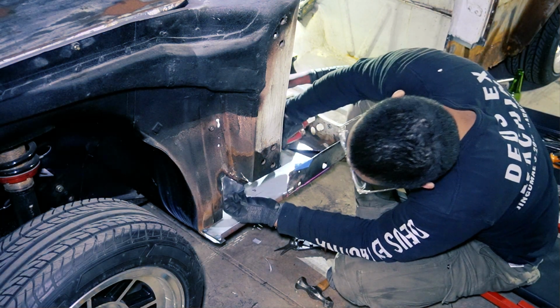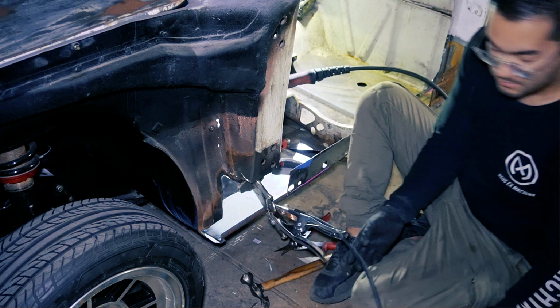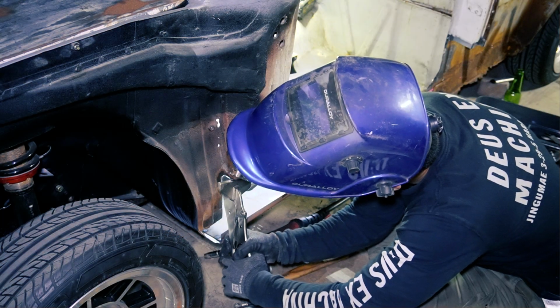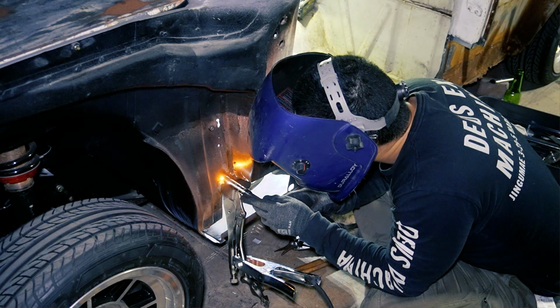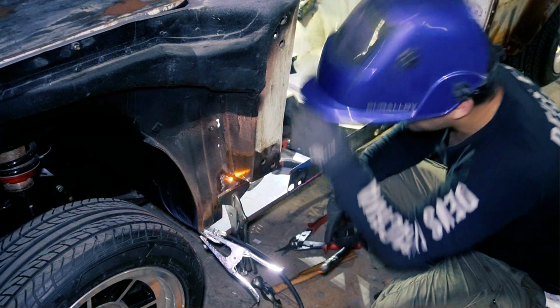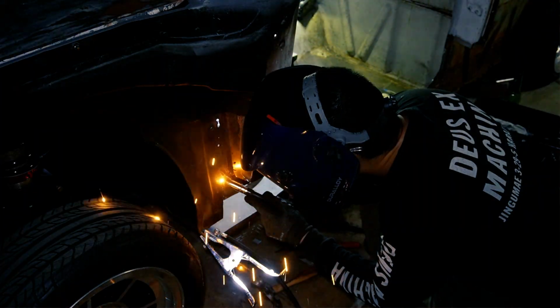And now, beginning the repairs for this run of flat section. I've found it to be personally easier to work in simple shapes, rather than to create a single patch panel with complex edges. It just results in that many more edges you have to align in one go. So for here, I'm welding in two triangle patches, making a nice simple rectangle for me to fill in next.